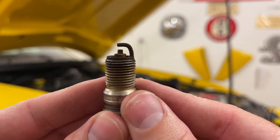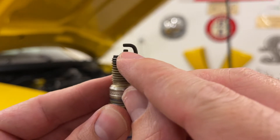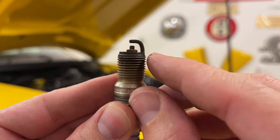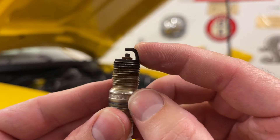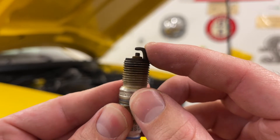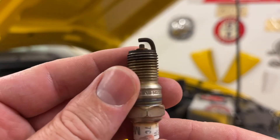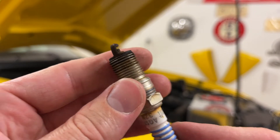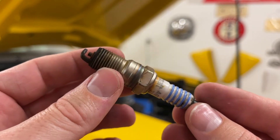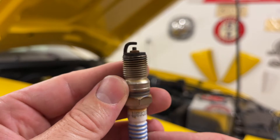Another thing to look at is the spark plug itself. You have the ground strap, which is the little arch thing at the top, and then this part is the electrode. That is making the connection to the ground strap every time the spark plug fires. You can see the gap — the distance between the electrode and the ground strap — and sometimes that gap widens over time. Sometimes with detonation it can be collapsed as well. You want to make sure that gap is the proper size; if it's too big or too small, it could cause problems. On supercharged cars, you usually will need to tighten that gap down — it's called gapping the plugs, and I have videos on that in the description.